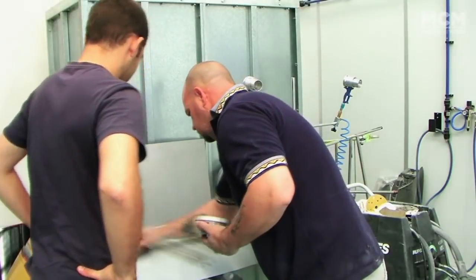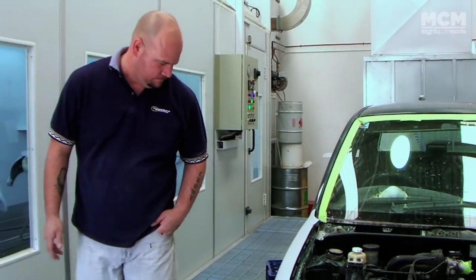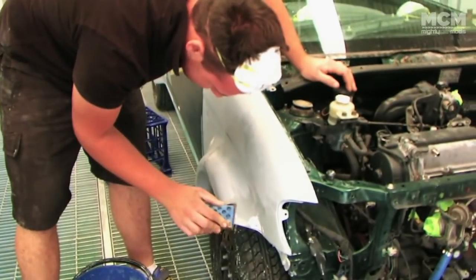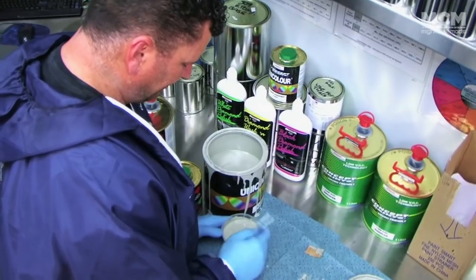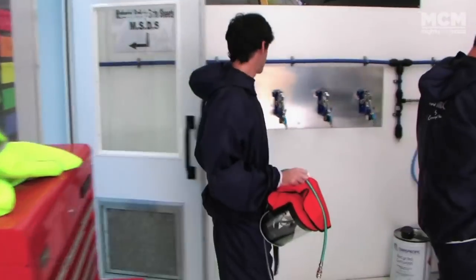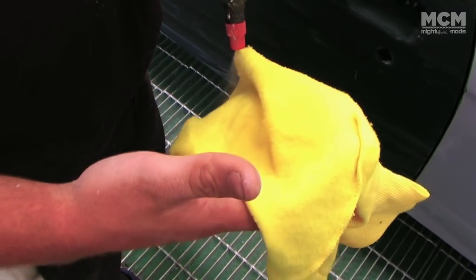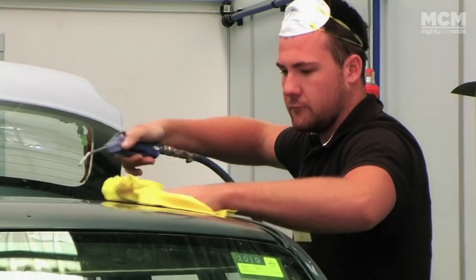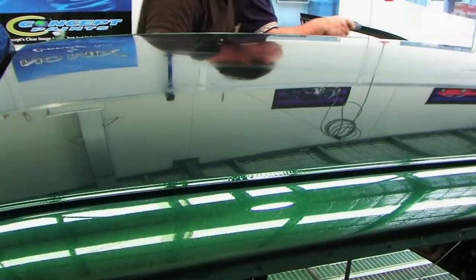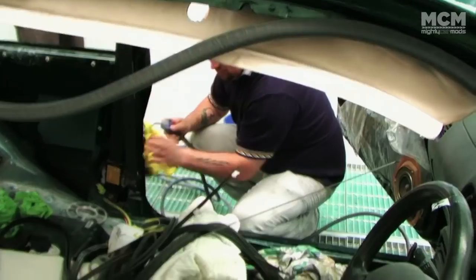We still had to wet sand the entire car before we could apply our colour. Any holes left in the primer were filled and our last coat of primer mixed up. Rake headed into the booth to apply it while Paul, Ben and I cleaned every inch of the little beast. The car is then rubbed down with Prepsol, which will remove any wax or grease left over, because even fingerprints can ruin the final result.